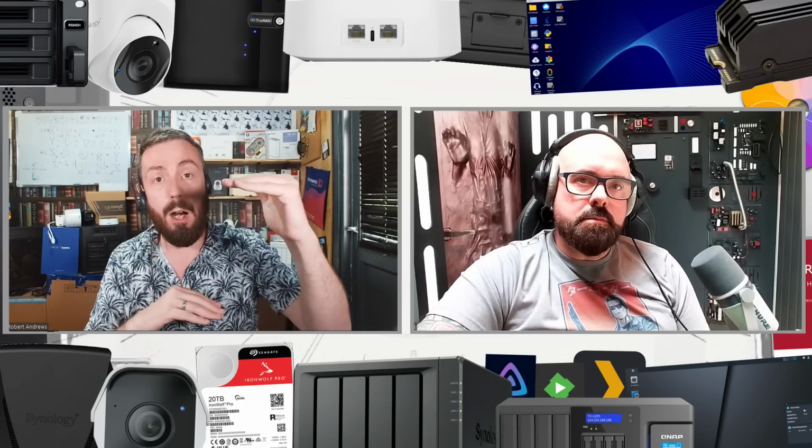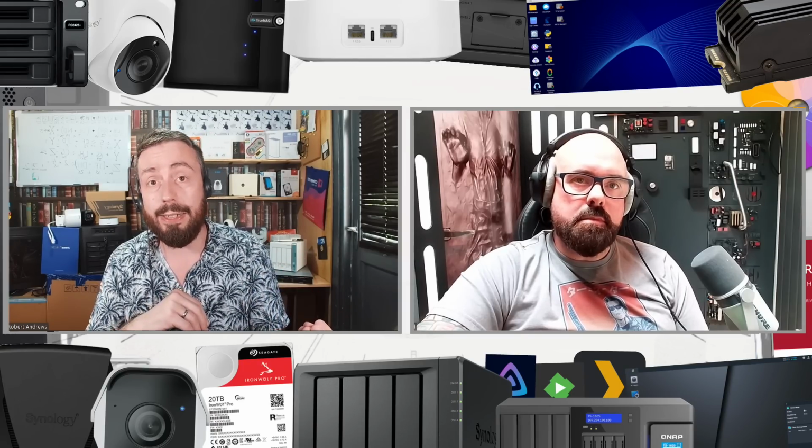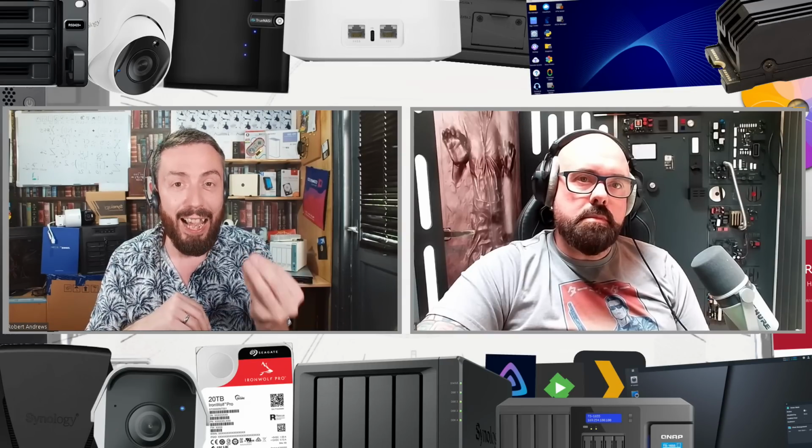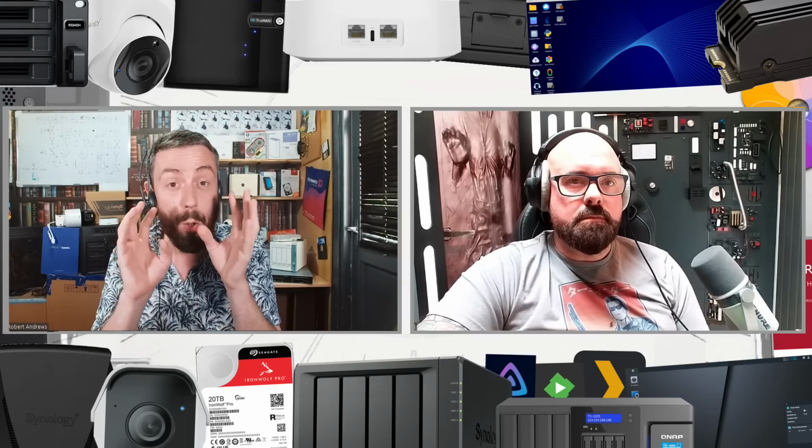and secondly, and probably more annoying than anything, when you look at Synology as a brand, they include that flexible RAID, but they stop providing it after you hit the SMB market. The minute you go towards enterprise or bigger business models, they've removed that feature, and you have to stick to traditional RAIDs. The reason they do that is it has a slight performance dip compared to traditional RAID systems. So it's never perfect. It has some of the things in NAS that you described there, but it's never realized as accessibly. I've said this in my UnRAID videos as well, nowhere near as many as yourself, that UnRAID is so fantastically flexible and scalable, and turnkey NAS has bits of it, depending on which brand you go for, but no single one has all of that.